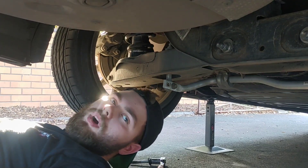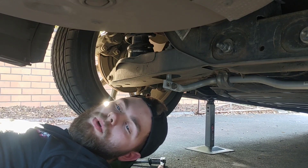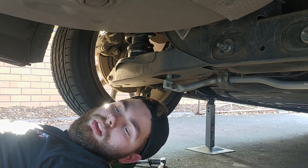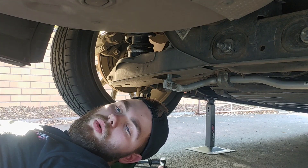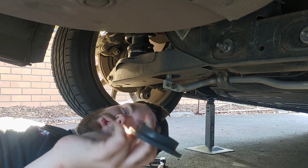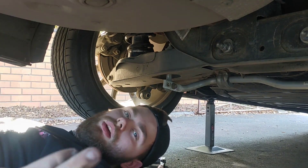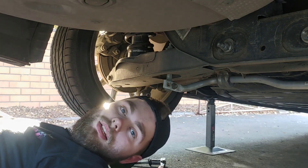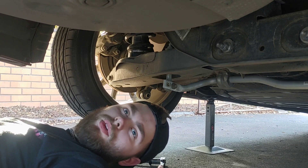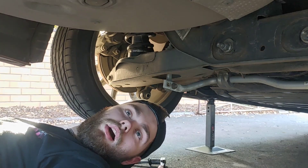I pulled the rubber out just while I was off camera from the insulator on top of the spring. I thought it was going to be totalled because of the driving I've done, but clearly I haven't done enough — it's just sort of warped it a little bit. This rubber insulator just sort of sits on top and on the bottom of the spring. I'll just put them both back in — they should be fine. The car will sit a little bit higher but it'll still sit pretty low, so yeah, it should look pretty good.